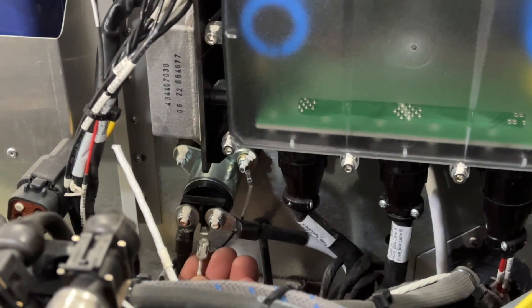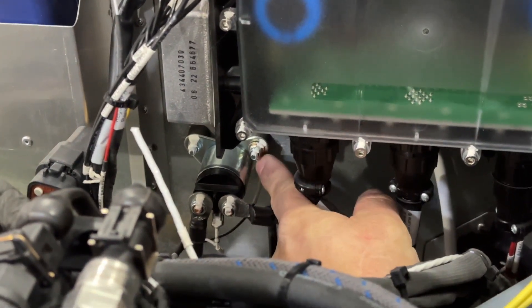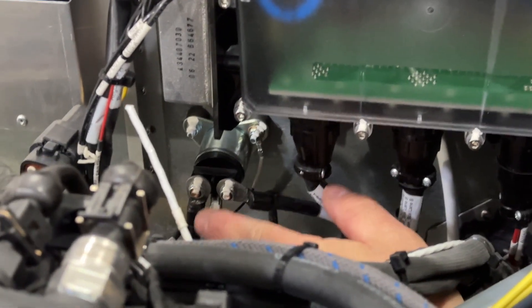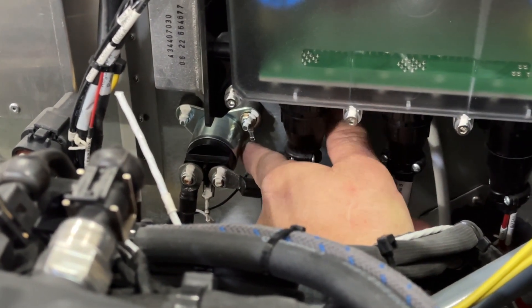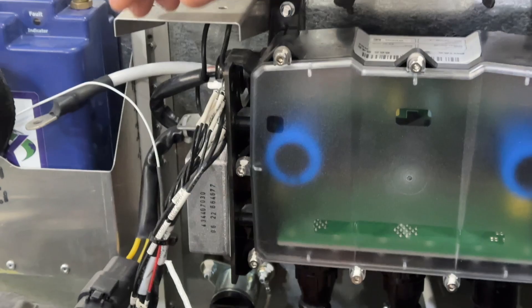This is what actually starts it. This is all good — most people figure this out — but where the problem comes in is this ring terminal that's back here. Because it's a ring terminal, it is often confused as needing to go on to this terminal with the battery cables. This is a ground. If you stick this onto that terminal you're going to send power right through your grounds and it's going to melt all the wires in the harness.